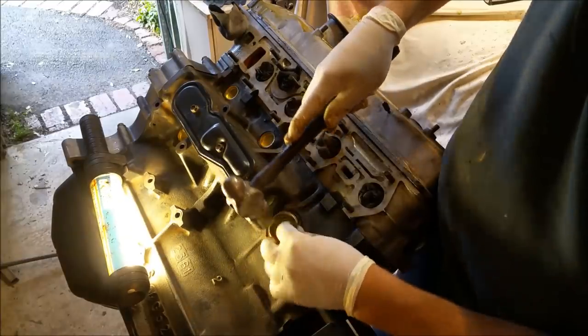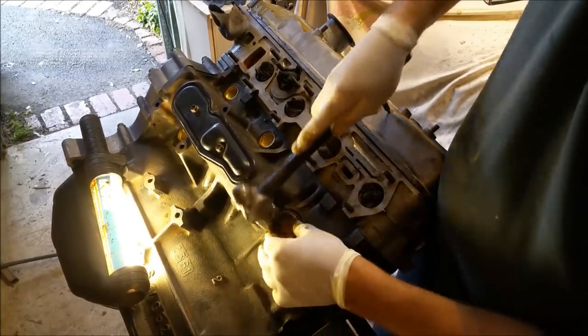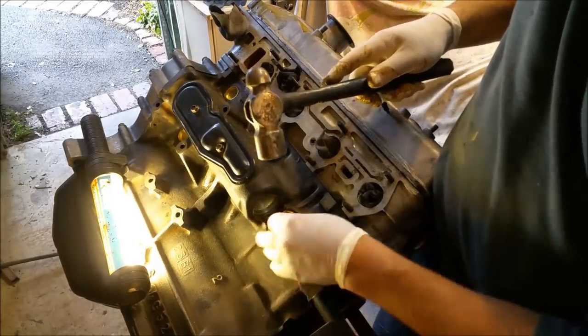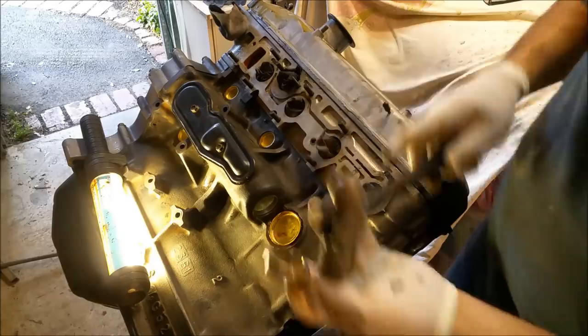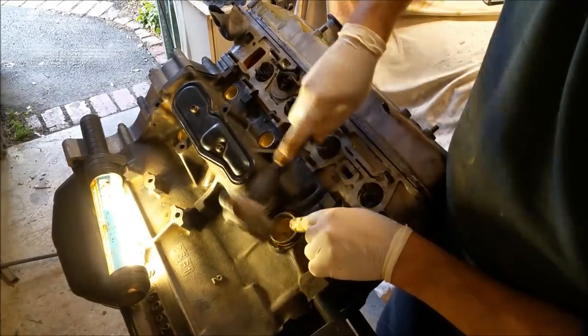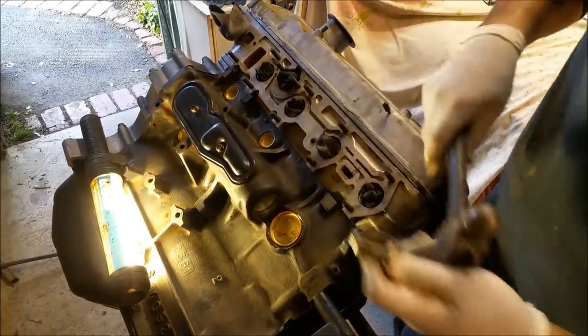I've got the blunt side down here, yes I do. It's going in. I can feel it. But it's better doing that than using a socket that's too small. If you use something too small, it's going to dent the center of it and take the tension out of it. Okay. Now what we're doing is we're aiming to get this one flush with that center part of the thing.